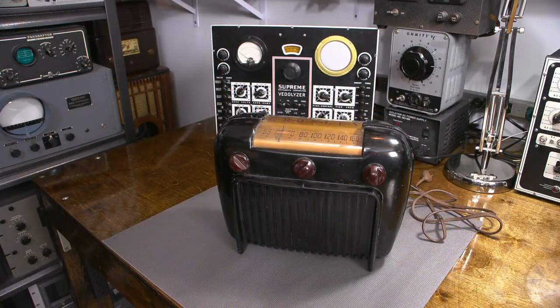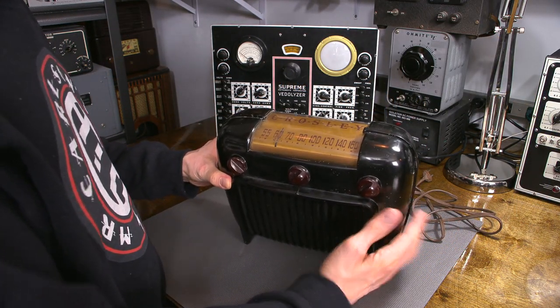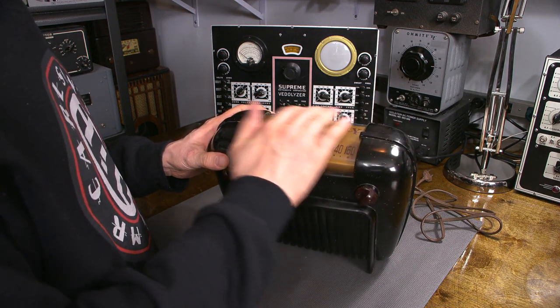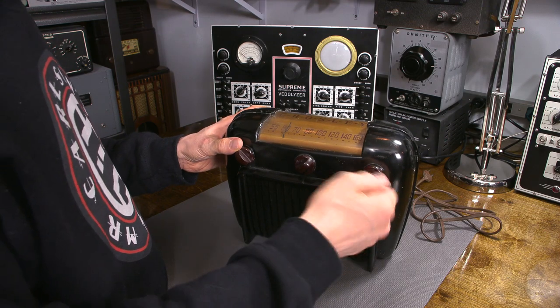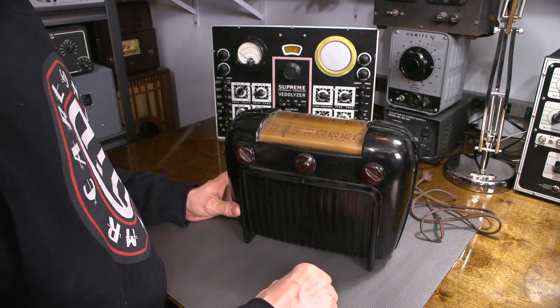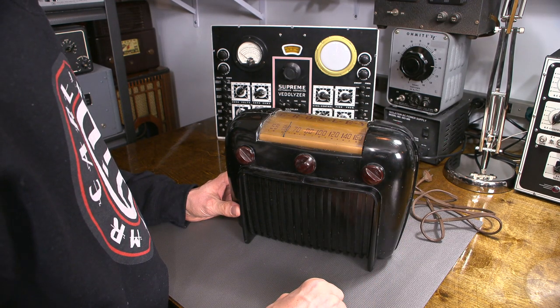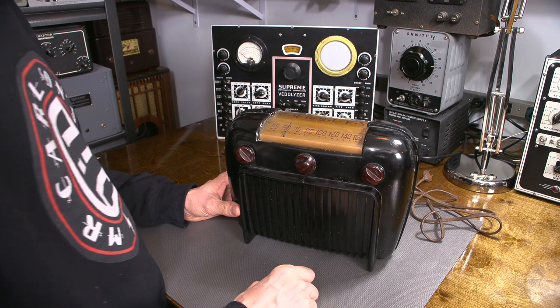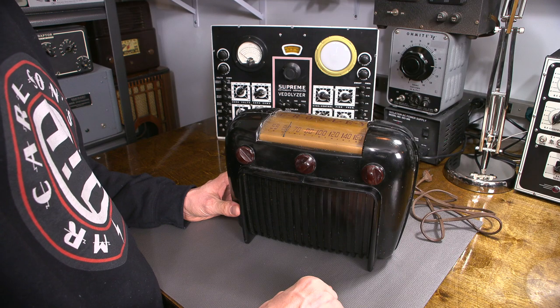Here's this really interesting-looking Crosley radio. It has a really nice-looking dial with a kind of gold color and a plastic cover on it. I've noticed that the tuning seems to be broken inside, so chances are the dial string has either come off or snapped, which is common for radios of these years especially after sitting for a long period of time.